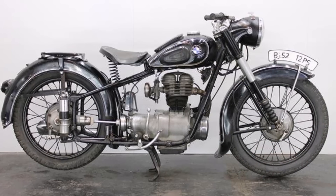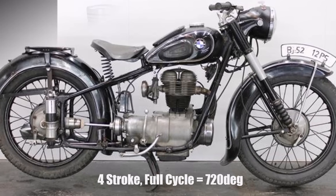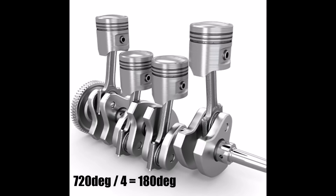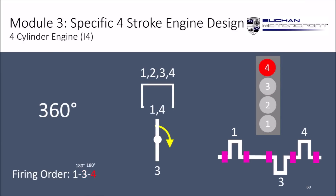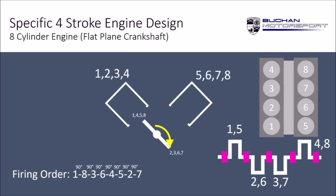Now what is that? If we design a 1-cylinder 4-stroke engine, we have an ignition every 2 revolutions, so 720 degrees. If we then design a 4-cylinder engine, we have an ignition every 180 degrees — 720 degrees divided by 4. So if we position all 4 cylinders in a line at 360 degrees, we can turn the crank pins by 180 degrees, so we have a cylinder at the top every 180 degrees for ignition. For a V8 engine, the firing gap is 90 degrees — 720 divided by 8. So I position both heads with 4 cylinders each at an angle of 90 degrees, meaning I can use the same shaped crankshaft, just with 2 pistons on each crank pin, and with this I will have an ignition every 90 degrees. That is a V8 with a flat plane crankshaft.